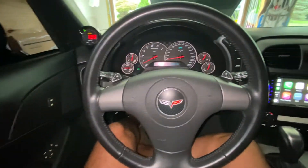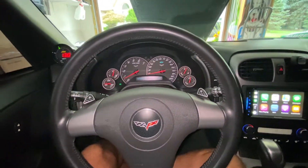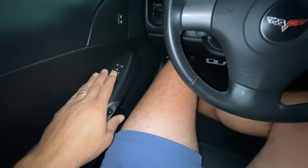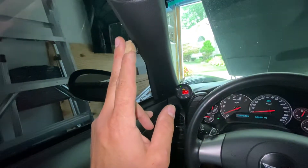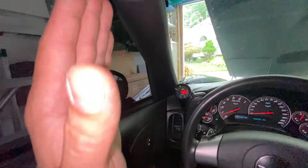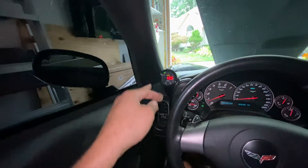The driver's side door, you'll hear a click first just because it's closer to you. But it's important to do this relearn. Most vehicles are the same way, especially if you have the auto down or auto up feature. Most importantly, on a Corvette, you have a cycle down feature when you open the door, so it clears the roof trim and the A-pillar trim.